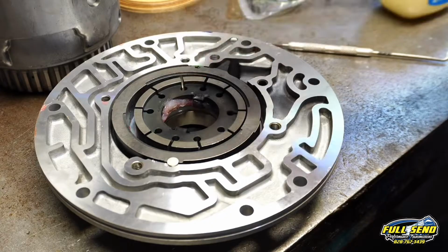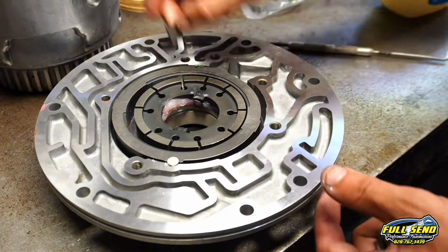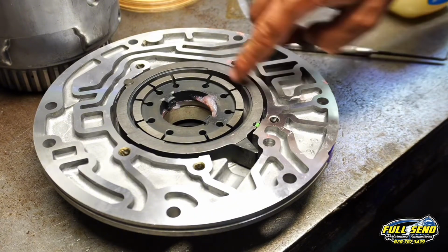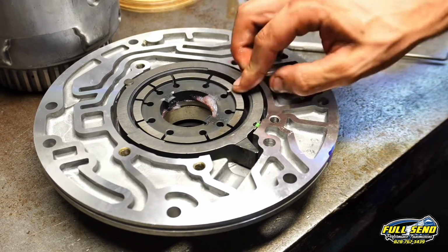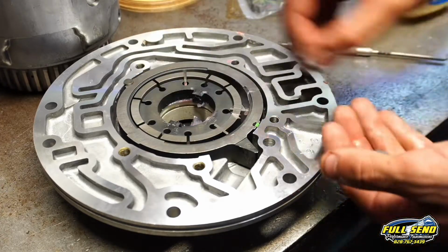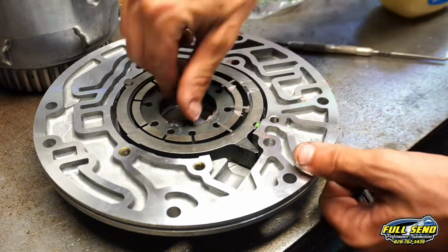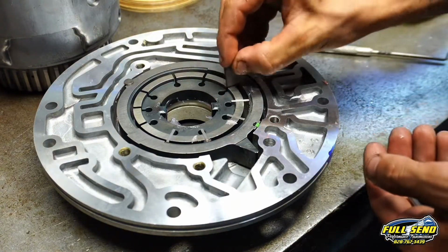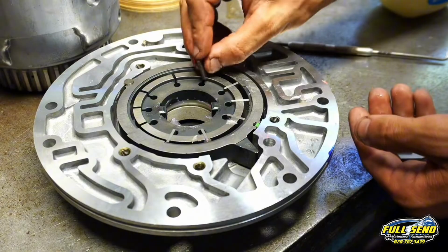Next, you've got 12 of these square pump vanes, and you want to rotate the gear body around where you've got a little space to get these things in. It makes it much easier. And then just spin the rotor 1/10 of a turn every single time you go to put one in. This makes it a whole lot easier, a whole lot more simple.